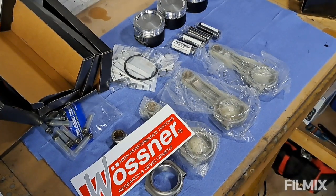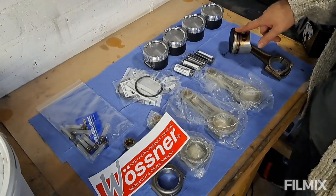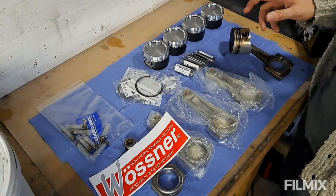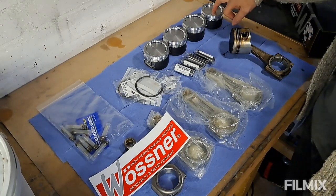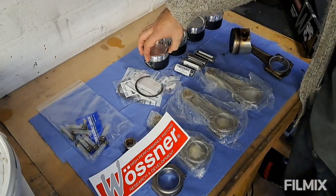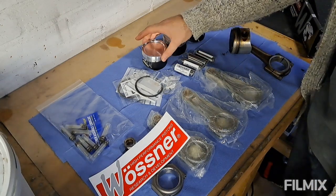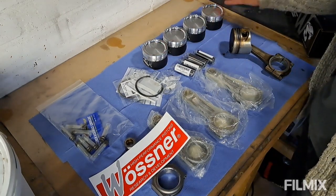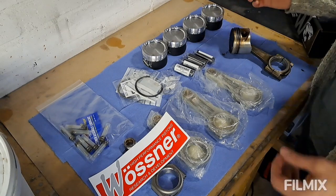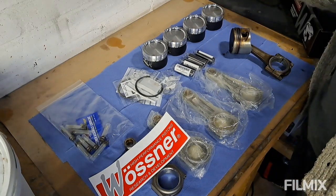I'll just talk about piston size. I've popped one of the standard pistons on the bench here with the rod attached — this is one that came out of the engine. These are a 78.5mm piston, which gives you a 1587cc engine. What I wanted to achieve was a true 1600, so I've gone for a 79mm piston — half a mil oversized. The block can take that. That'll give us a true 1600 and all the cylinder bores will be fresh as a daisy, essentially creating what will be almost a brand new engine.